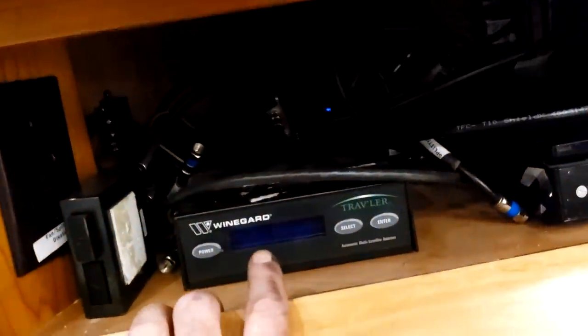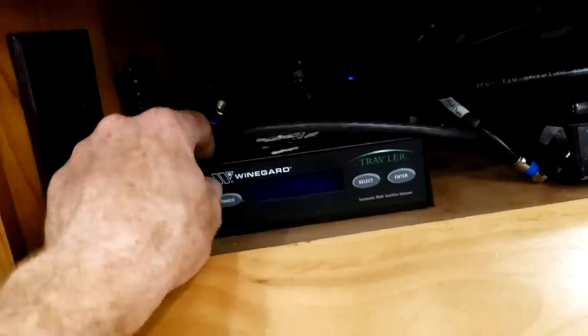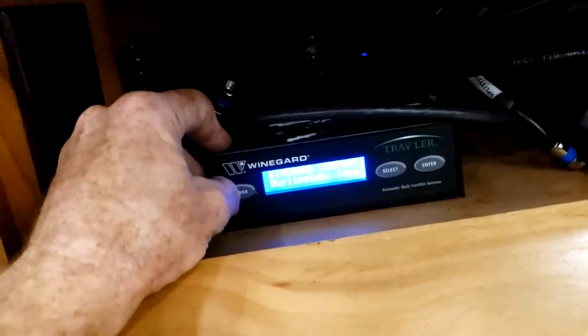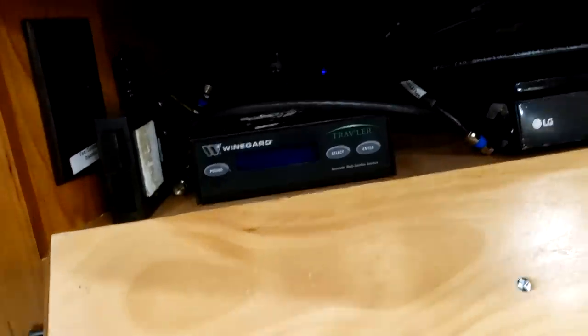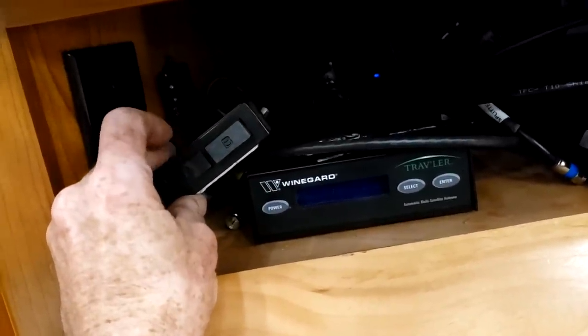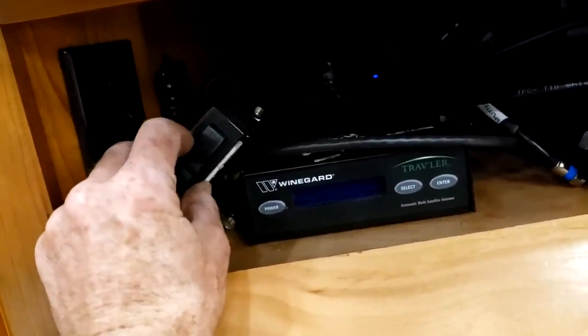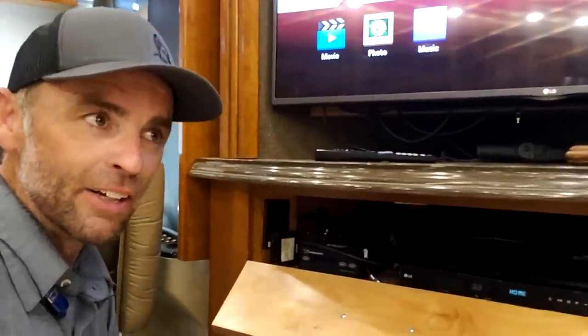Right here is your satellite non-in-motion — this is your Winegard Traveler, set up for Dish Network. Push and hold that button down; it will say connecting to antenna, then let go and it will automatically go up and find the antenna. You have your selector box for satellite — dome satellite dish or traveler satellite dish, whichever is hooked up to your coax. We always recommend having an RV tech install it correctly rather than dealing with the subscriber, since they won't help you out very easily on an RV.